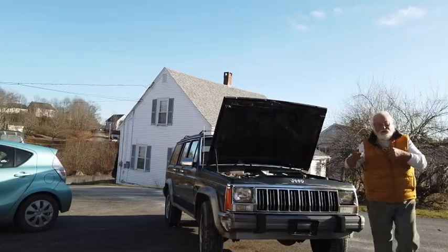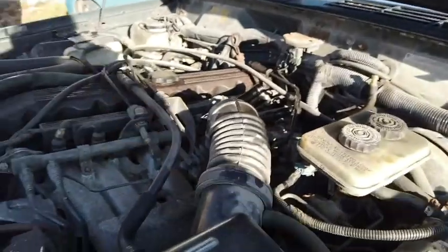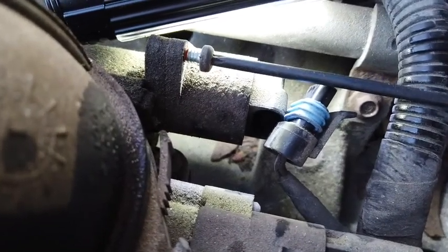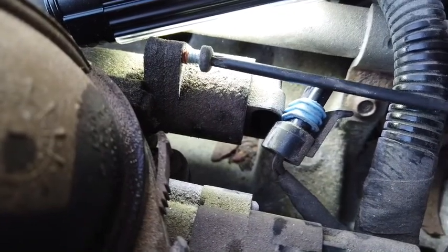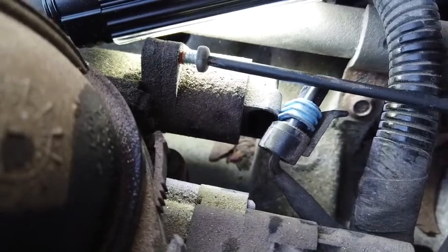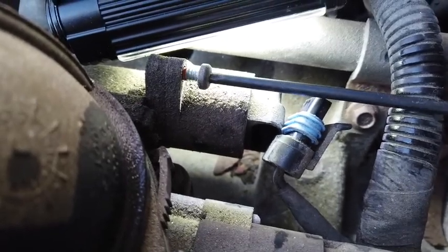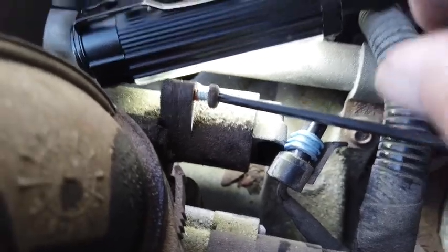Now, I mentioned a while ago that as you're turning that and you hear it click, you'll know it's loose, and that might not have been real easy to understand unless you see it. So I'm just going to show you on this one because it's up top. Now you see that screw there. Now I'm putting pressure toward the front of the car, pressure down on the screw. And as I turn it, once it goes past where the threads end, you'll see it click, and it just did it. See that click right there? That's me pushing toward the thing, and as the screw comes out in the threads, it'll reach a point where it don't go anymore, and it'll click back down in there. That's how you know that it's loose.